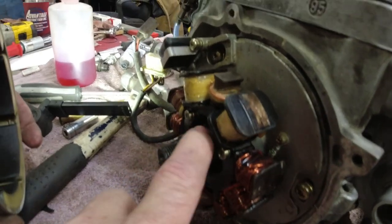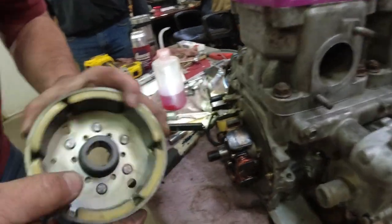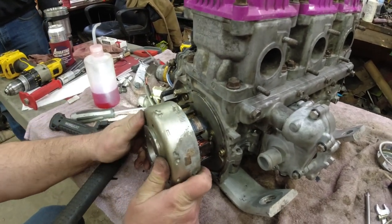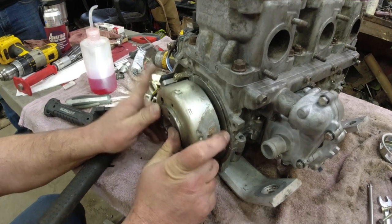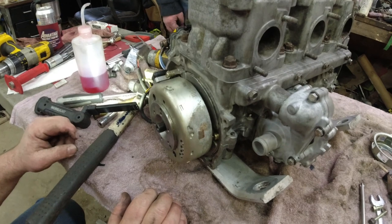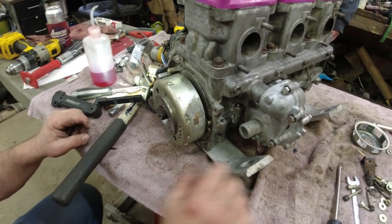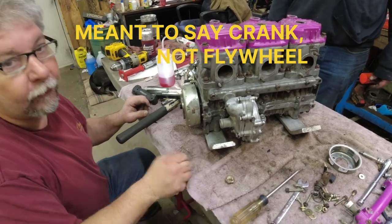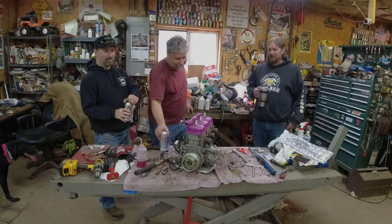Key stayed in. Okay. So the key is at a slight angle. And the groove, as it went on, it just seated the key. So that's why I wanted to make sure we didn't accidentally knock the key out, but that it seated. And you could see it's flywheels all the way down now. Not a typical thing, only if you got a brand new flywheel. So we'll get that torqued down real quick.